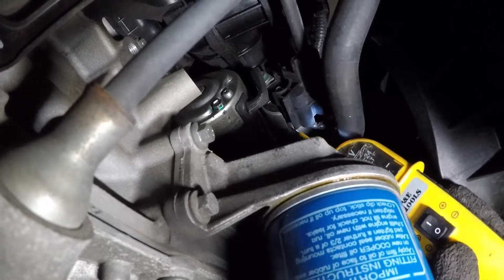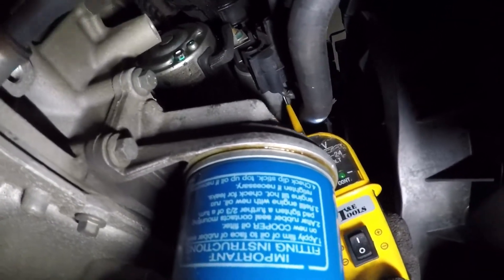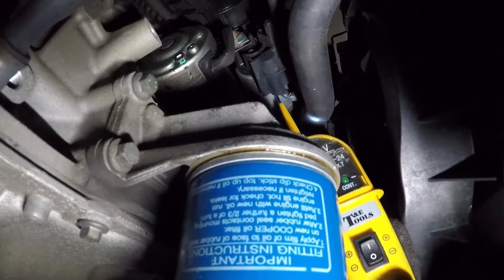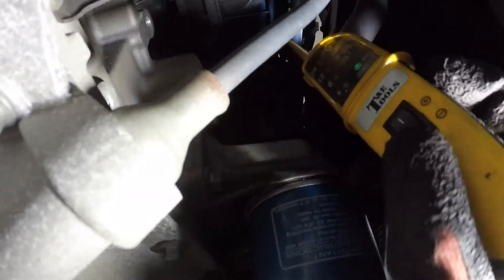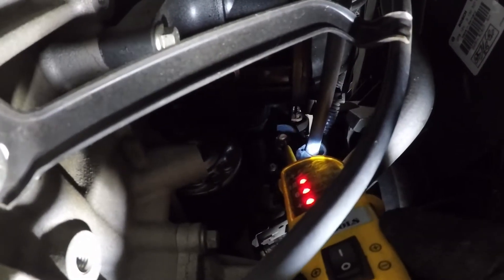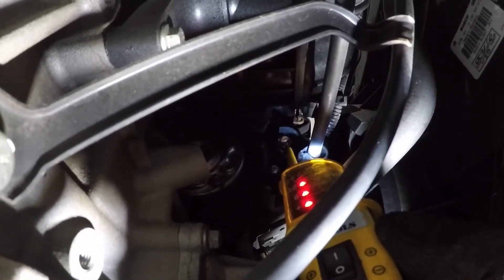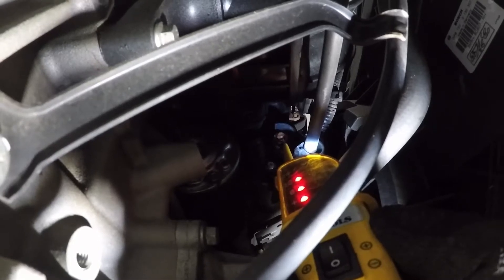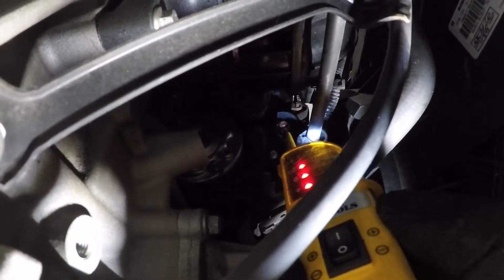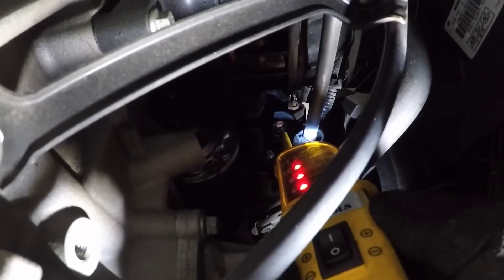As I go on and off you can see that - that's the ground. That shows the ground, which is the advantage of having one of these tools. And if I go up to the top here, that's the main power feed, and it's got three actual LEDs there, which tells us it's 12 volts. If it was anything less - six volts it would show two LEDs, less than that one LED. So we know there's a full 12 volts there. At the moment the body and the main wire are good - we'll go upstairs and check that trigger wire when we're cranking it.